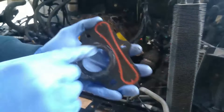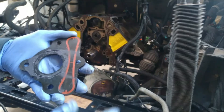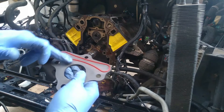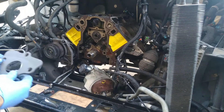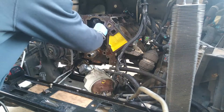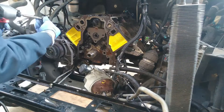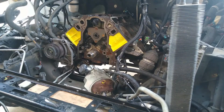This is the old cam plate, also called thrust plate. Just look at this gasket — it's all smushed down, I can run my finger across it and I don't feel anything. This seal is dead, there's no bulge at all. Here's our new one fresh from the factory — it's got a nice indentation there, I can feel the raised bump unlike the original. These need to be torqued down to 18 foot-pounds of torque.